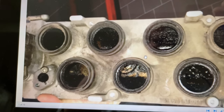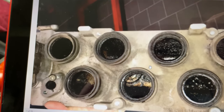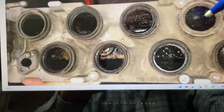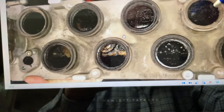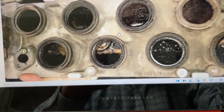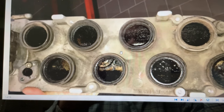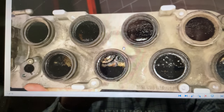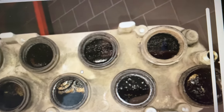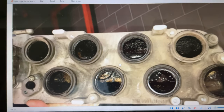The easiest way to clean it is probably with a mixture of acetone and MEK soaked first — do that outdoors because the fumes are intense. You remove everything, soak the whole manifold, then brush it out. This will take a while unless you know someone with an acid wash machine that can run it through with special solvent. I'm probably going to bring the upper manifold to the engine shop here in Kansas City that still has an acid wash machine — I did this with a Jaguar XJ6 years ago and it worked out great.